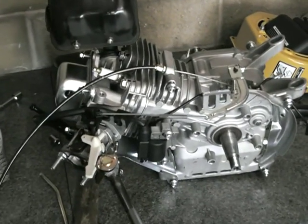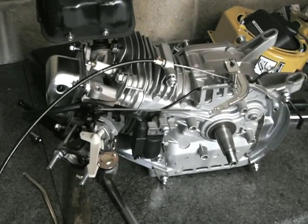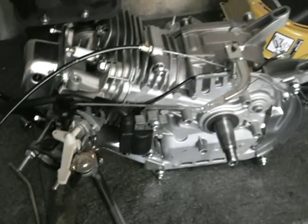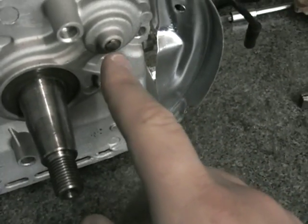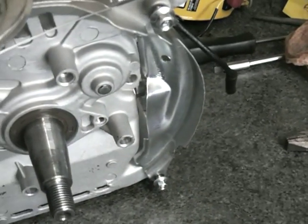That's the new GX200 clone engine I got off eBay for 90 quid — £102.50 including postage and packaging from Pumps UK on eBay. I've taken the governor off, which is that gear plus a bit of shaft and a couple of washers, so the engine can freely spin up now. It just went on the other side of that stud, so I hammered that through, let all the stuff fall inside the crankcase, taken all the bits out, then cut the studding off and tapped it back in from this side just to stop oil from leaking out.